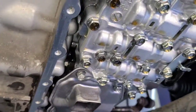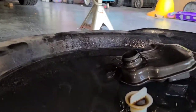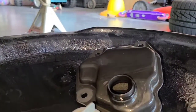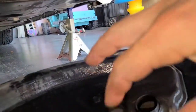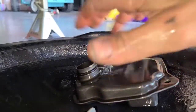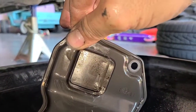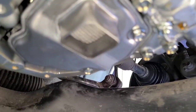The new strainer's in. There's the old strainer. Make sure you take the old o-ring off if it happens to stick up in there - probably won't, but make sure if it does you take it off because the new one comes with an o-ring. Just make sure you wipe a little bit of transmission fluid around the new ring before you put it up in there, and then push it and it'll slide right into place. That's the old one, and there's a new one ready to get dirtied up.